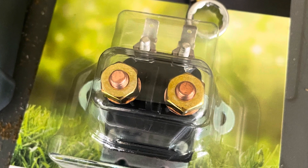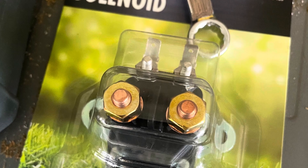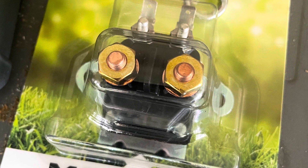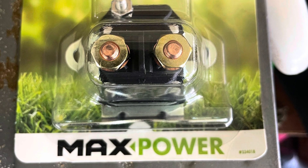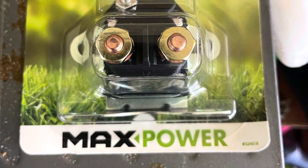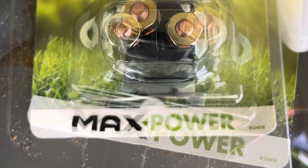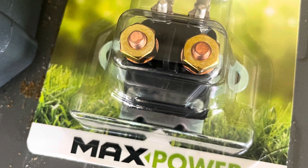We're going to share something extremely important: this is a four-pole solenoid that people like to go to, but if you don't have the proper tools or the ground wire to switch from a three to a four, you're going to be doing it wrong and it won't start. I went direct replacement from a three-pole back to a three-pole just so I could bolt everything back up the way I had it. Here's another look at the four-pole so you can understand the differences between it and a three-pole solenoid.